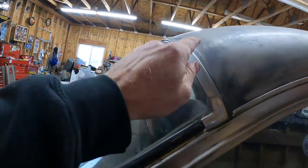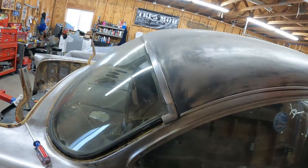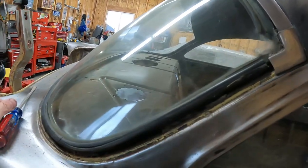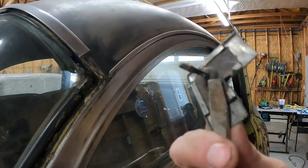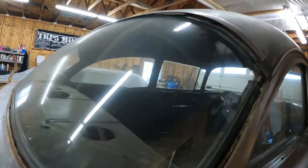First thing I'm going to do is try to get some of this stainless trim off because I got the side mostly ready. My buddy David from Tri-5 Bob let me know there's a little nut on the inside that I just took off. You take that nut off there — see the little stud? Nut inside, take it off and then off she goes.